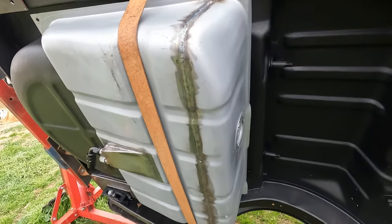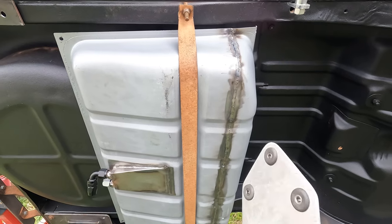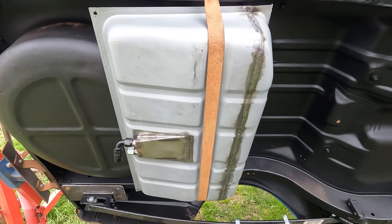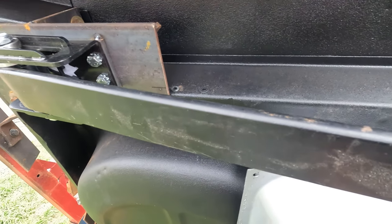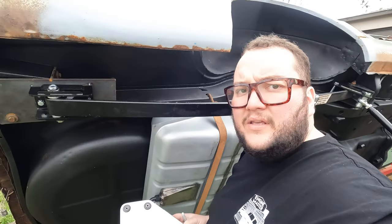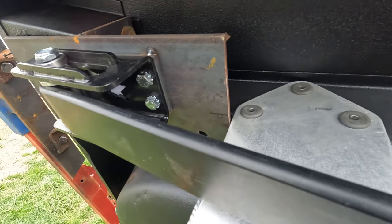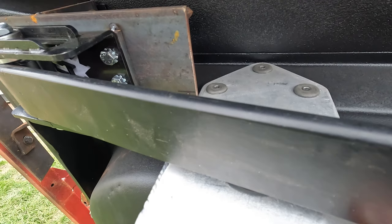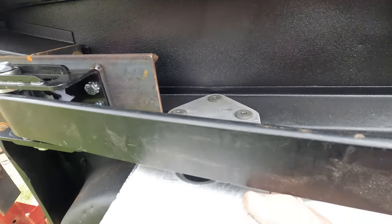There it is — modified tank all in. Thanks for your comments, tips and suggestions. I'll know for next time. The guy that was worried about it holding pressure — it has held 20 PSI all night, so no problem. We're going to need to mount the pump first. I've already got two nutserts up in there from the previous pump, so instead of drilling more holes we'll use one of them. Only problem is it hits on a hanger, so we're going to put a little relief in there, add three more nutserts, and we should be good. We've still got plenty of clearance everywhere else.